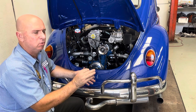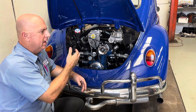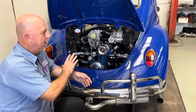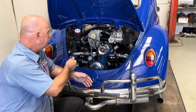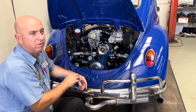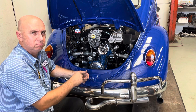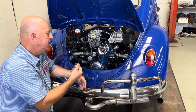You can do it in little bits and pieces, with twin carbs and that sort of thing, and you'll pick up a little bit here and there. Mick, who designed it, says that the stock 1600 engine is around about 50 horsepower. The supercharger kit should take it to a bit over 80. Then with the better ignition and the better exhaust, we may have gotten a little bit more, maybe got to 90, I don't know. Once it's fine tuned and we get the air fuel correct, we may even then have to look at the timing a bit more, but it certainly wasn't a bad job